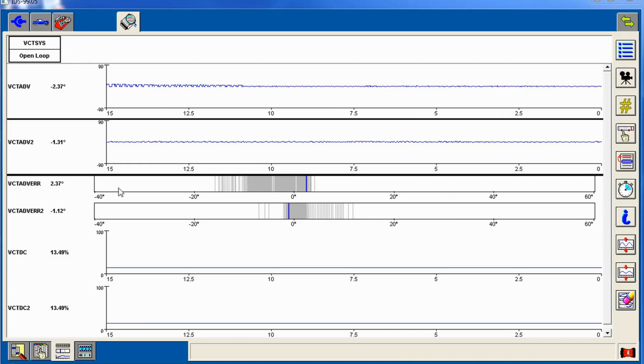Let me get to an appropriate straight section here. Not really giving it some gas. See how high up it went? Now we're stopped. It's still advanced a little too high, but when it's at 30 or so degrees of advance is when it actually makes that knocking noise, feels like it's going to die out, all that good stuff. So you're pushing oil through it, and that solenoid's sticking.